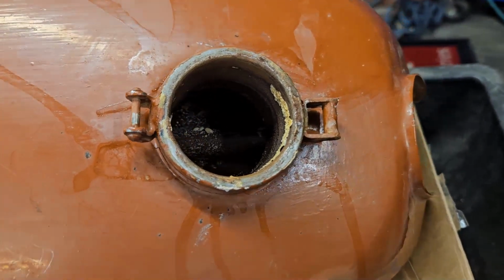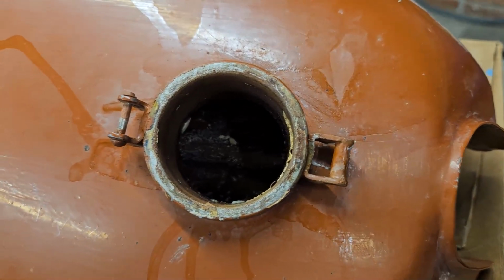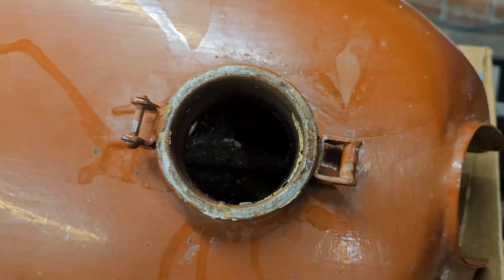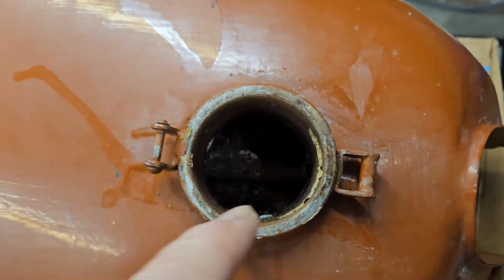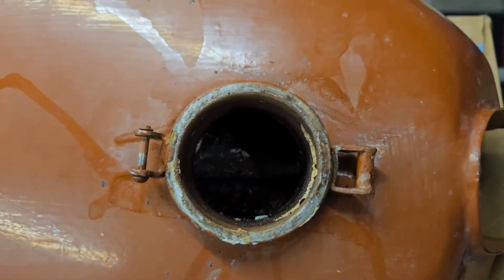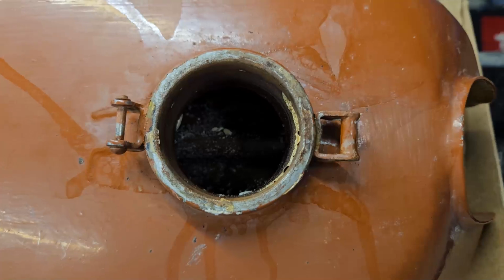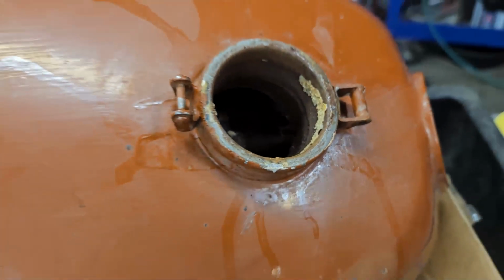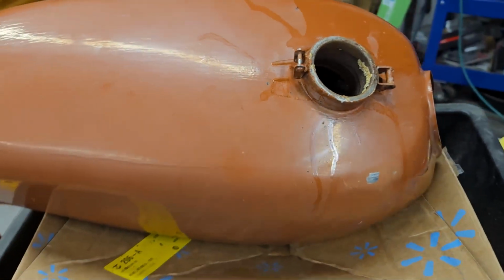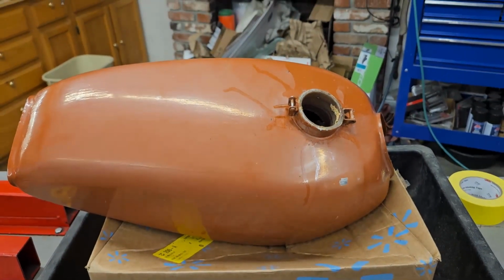and we're going to give it an overnight soaking. And I bet, if you ask me, it's all going to be out, or at least it's going to be free inside the tank, inside of all the acetone. Now the acetone supposedly will dissolve it to where the acetone will just look milky, but we will see.